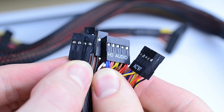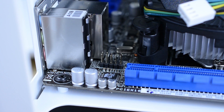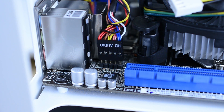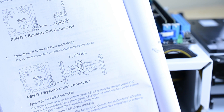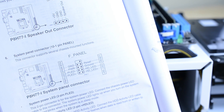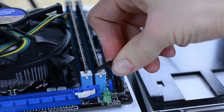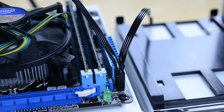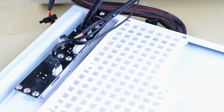The rest of the cables are a bit more tricky, so keep in mind the little arrows — this means that side is positive, which is important to pay attention to as we connect everything. First grab the cable labeled HD Audio and connect it to the motherboard behind the graphics card. It might be easier to remove the graphics card if you can't get at it. Now find the manual for the motherboard and look up the pinout labeled System Panel Connector. This is the easiest way to see where the rest of the cables connect, but be mindful of plugging the positive and negative ends correctly or else you'll have to fix them later. Behind the rim is where you'll find the connectors — they just slide into place like the audio. Take your time and make sure each is inserted correctly; it'll save you a headache later. It is a bit tedious but no big deal really.